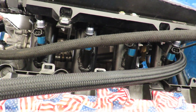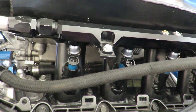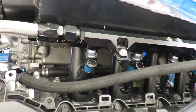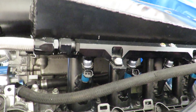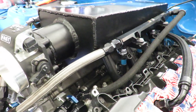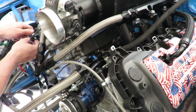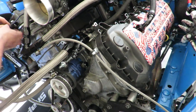Running ID2000 fuel injectors. Going to be using Ignite 114 fuel — it's 90% ethanol, 10% race gas. Are the ID2000s good for ethanol? Yes, you just have to clean them more after race season. They just don't have stainless internals.